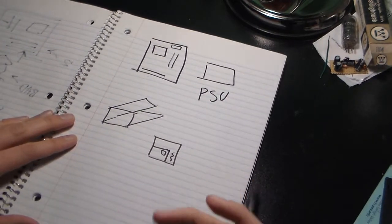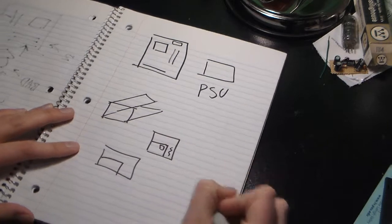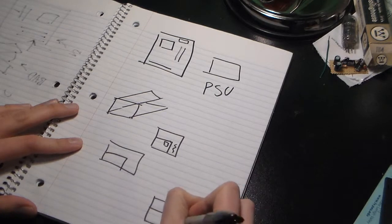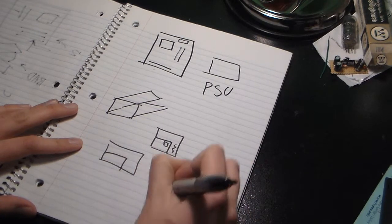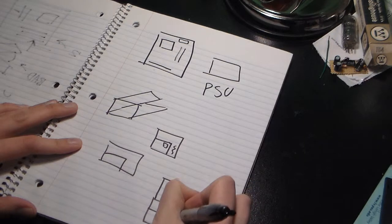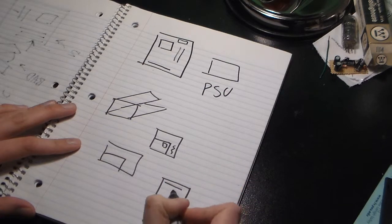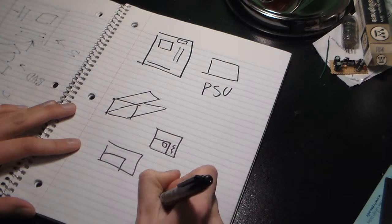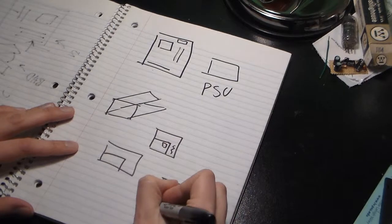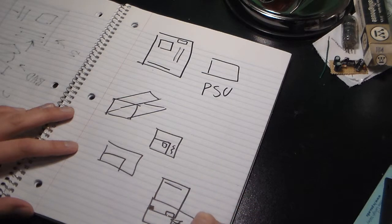If you look at it from the side, it'll also just look like this. Now, the idea behind this is, now that you have your bottom box with your power supply laying in it and all your cables coming out, your motherboard will go on, and you'll flip it upside down, so your expansion slot is at the top, sort of in an OEM fashion. Your audio connector or PS2 connector, whatever will be on the end, and your power supply connector will be right here.